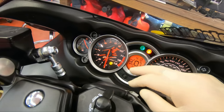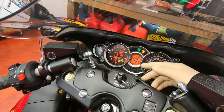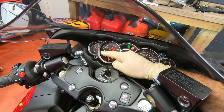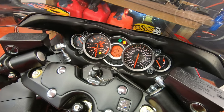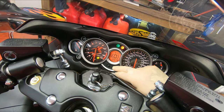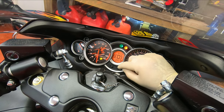You can see it took it, because it has that light bulb right there. On these Gen 2 bikes, the rev limiter is 11,750, so my light is going to come on at 11,500. I also want to mention that my button has some issues — it's not making good contact, so that's why I was pressing it so many times.